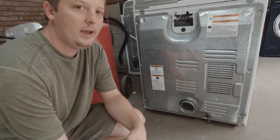If anything is weird, don't sell to them, don't deliver — if they're not gonna fix the problems you don't want that kind of problem. You're just gonna be going back there a million times fixing burned up heating elements. While we're still on dryers, the next thing to check during delivery is the exhaust line — make sure it's not stopped up from the back. From the machine forward, if you're following my instructions, you've already cleaned out every spot in the machine that could have lint.